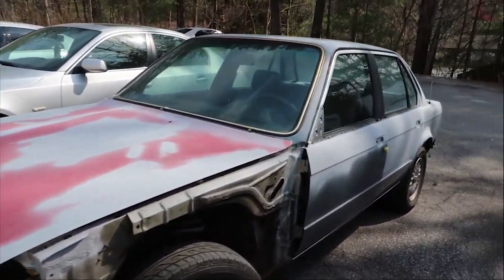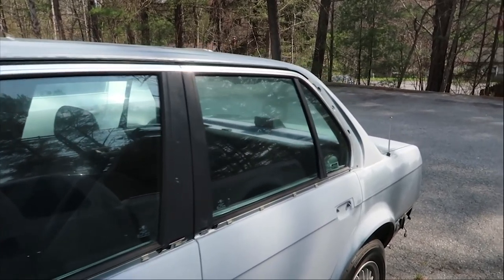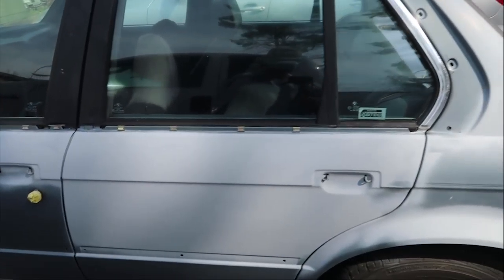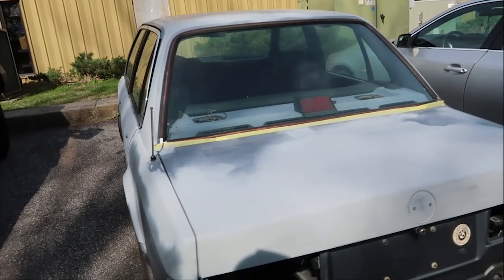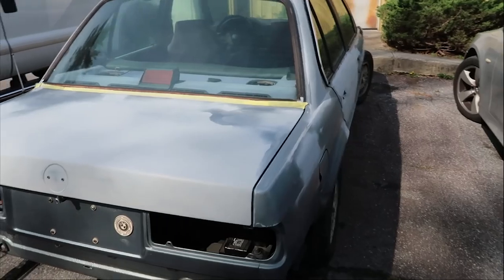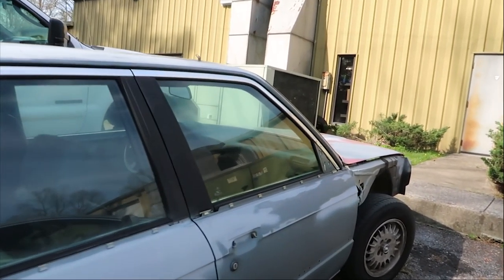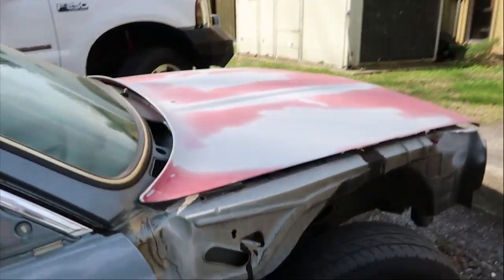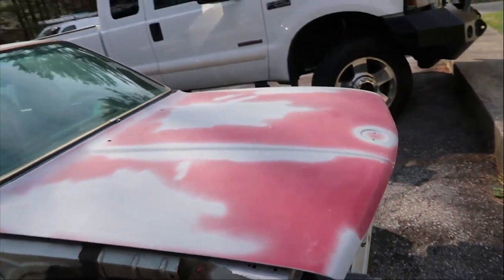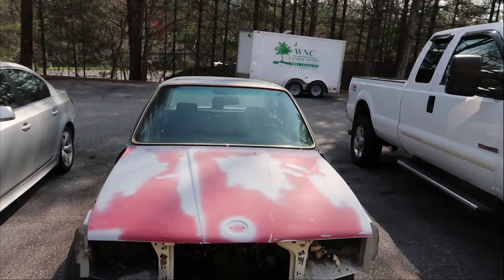So you can see that I got some spots primed out. You've seen the other videos, I was bonding it. And I just used a can primer just to cover up the bare metal parts so it won't rust. And hopefully sometime this week, maybe next week, you can see I already sponge sanded everything. I will continue to finish up the two fenders. I need to still sand them down and finally lay a nice thick coat of primer on it.